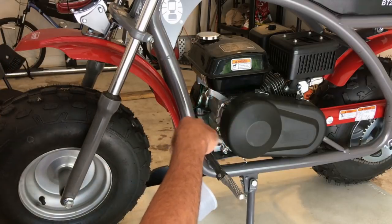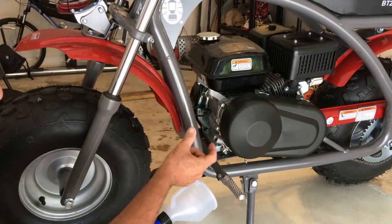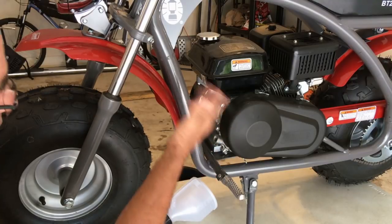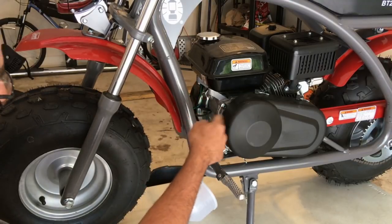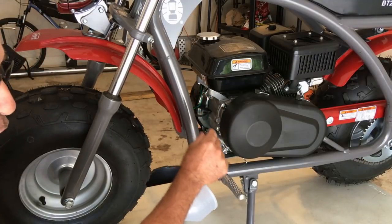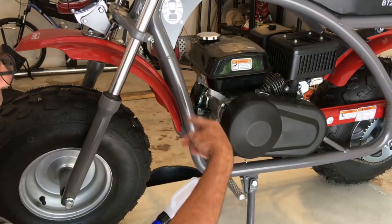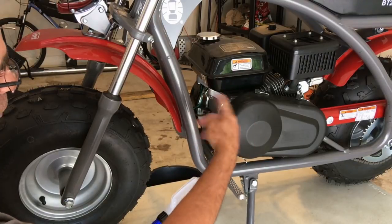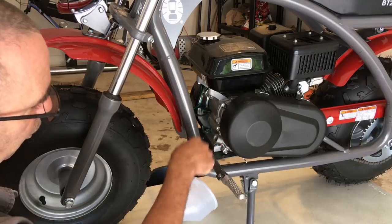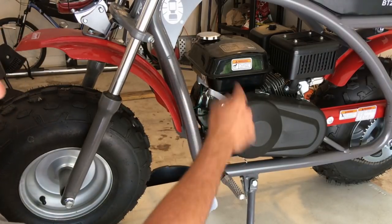These engines have a rod that goes to the piston and then bolted to the rod, well, the other end of the rod, I should say. And then, you know, it mounts to the crank. Well, there's like a little thing that comes down. It's like a spoon or a splasher. And so as the engine's spinning and spinning, that splasher's going down into the oil sump. That's the way these things work, and it splashes oil all over.